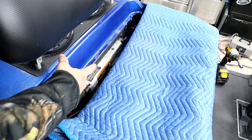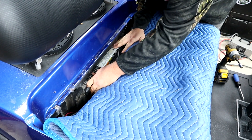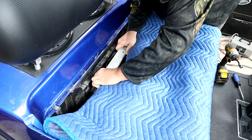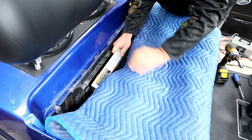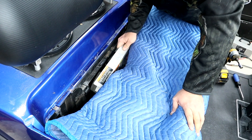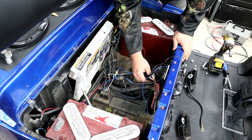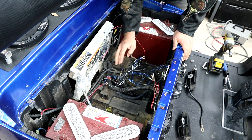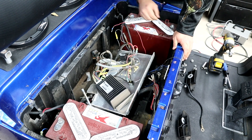With our batteries covered up, we can take our T40 and remove the main plate bolt. These panels can be pretty stiff sometimes — make sure you get all your wires pushed back. Looks like we may have to pull the two center batteries out, as the 12-volts are sitting quite heavy. Now with the two center batteries out, there's a lot more room. Whoever built this cart before certainly didn't do themselves any favors, but let's focus on the controller — it lays in there nice and neat now.